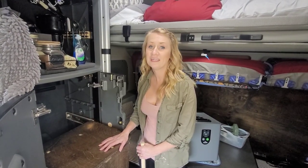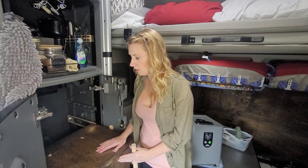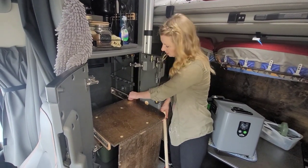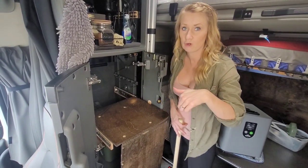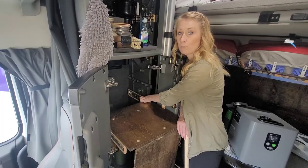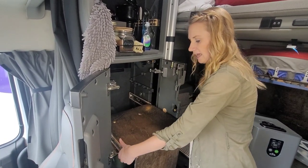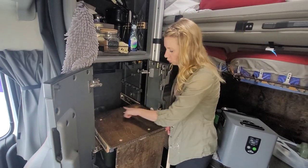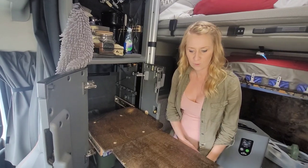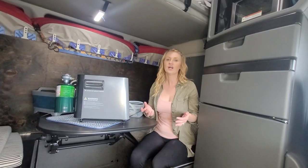Let's talk about how we added this cabinet into the shelf. We did not do any permanent damage to the truck, so it won't affect resale value. We made a trip to Lowe's and got a dowel rod, a big piece of board which we cut down, a piano hinge, a drill, two pieces of board, and two casters. I screwed boards in for a permanent mounting for the casters, knocked them out a little so the door could clear, then added a piece of wood on those casters and drilled holes for the hot water heater leg. The piano hinge holds the dish pan when doing dishes, and it doubles as a cutting table or prep station.